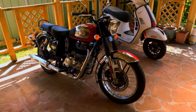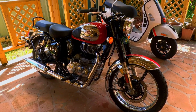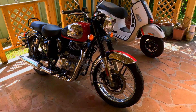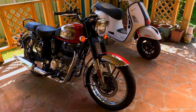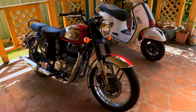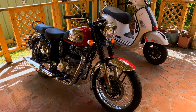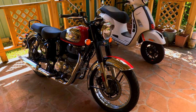I'm in the running stage on this Classic 350 Reborn Red Chrome. It's roughly 22 degrees. I noticed when I usually run 10 or 15 kilometre runs, you find that when you come back you can smell how warm the motor is on these new bikes until they're run in. So that's why it's always important to do your running carefully, don't overdo it, and don't stress or overheat the motor.